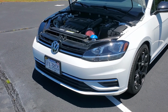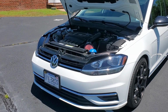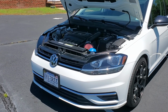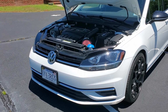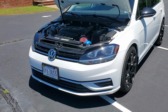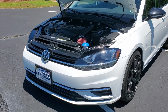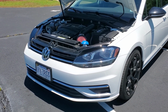But the low beams are where you get a lot of drama and discussion online and arguing about the notion of putting LEDs in halogen reflector housings. Now, a couple things I will tell you is, number one, there are factory LEDs, like on my Atlas, that come in a reflector housing. So it's a purpose-built reflector housing for an LED, but nonetheless, it is a reflector. So the mantra of only in a projector really doesn't hold for LEDs. It does hold for HIDs